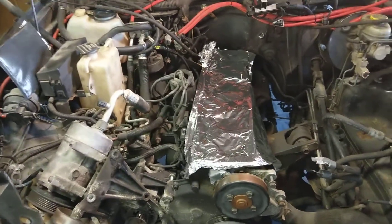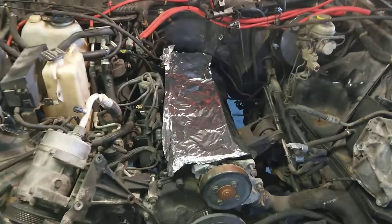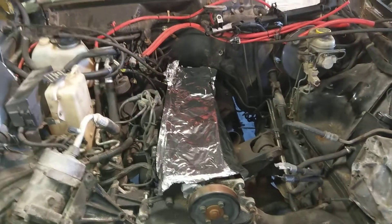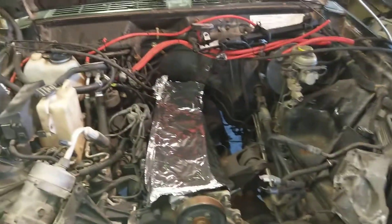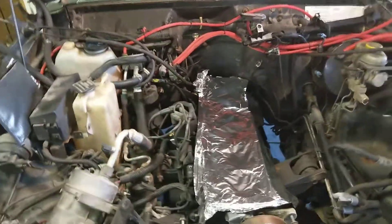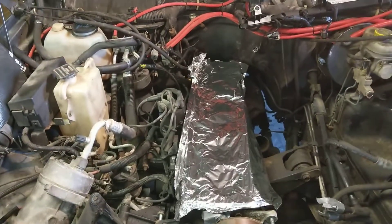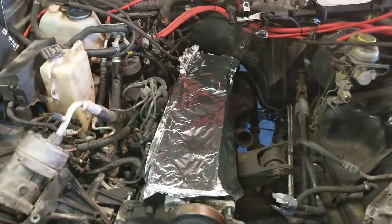This year I decided to pull it out and do some work on it. I bought Engine Restore hoping I could fix the low compression without tearing the motor apart yet. But when I went to replace the PCV valves — I had broken one previously and just stuck the line on it — I pulled them off and found chocolate milk. Found it under the oil cap as well. Pulled the dipstick: reading about two quarts high and completely chocolate milk. I knew I was in for it then.